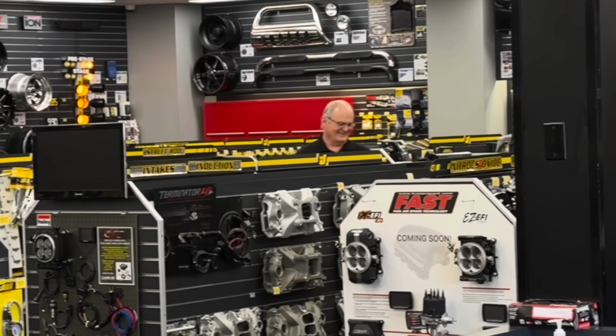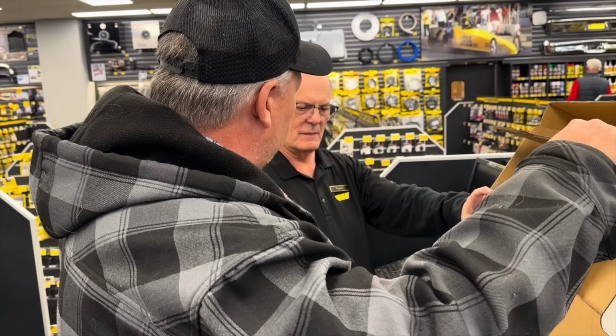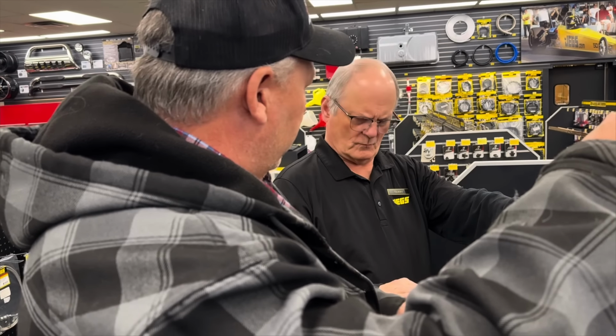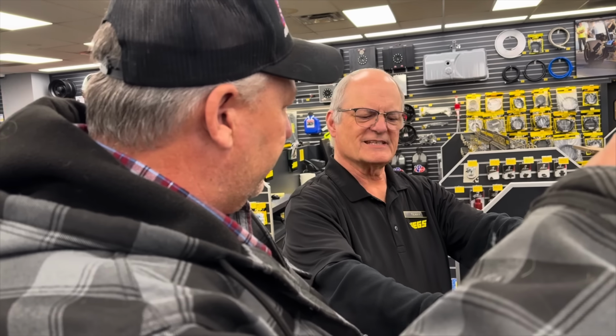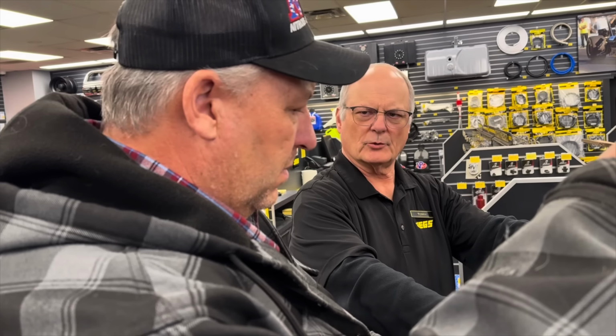So I went straight into Jegs to see Uncle Terry to pick up a new intake that should help solve some of these fuel distribution problems. When I put it on E85, it's like the more fuel I have flowing through the intake manifold, the unhappier it gets. It just does not like it. So I want to try a single plane on it. Well, on the test that I read about it, take the dual plane off, put this on, 30 horsepower. Oh. That's all they changed.